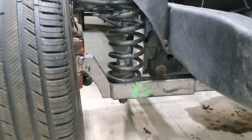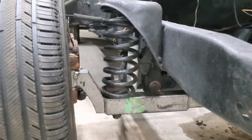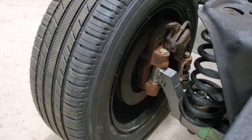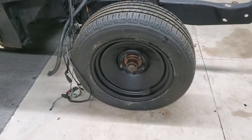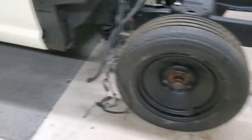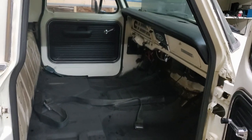We're going to turn it into something cool. For starters, I've got the DJM lowering I-beams along with the shocks, and I went with disc brakes up front from a '77, as well as the power steering from the '77. I upgraded the wheels as well - going with 17-inch US wheels in their rat rod style.